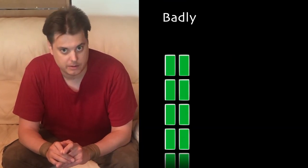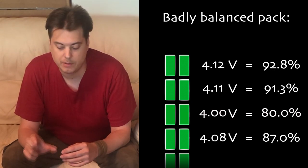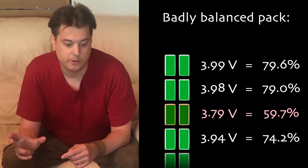So then why did I make a video about it? Because if you stop the charging at 80%, you will kill the battery pack much, much sooner. The one thing that the EWheels site doesn't address is the BMS — the battery management system inside the electric unicycle battery — which has to balance the individual cell groups so that every time you charge and every time you ride, each cell will be close to the same voltage.